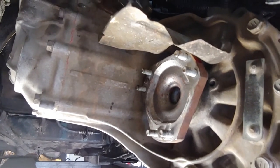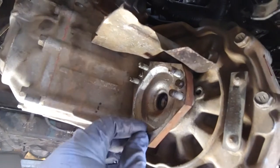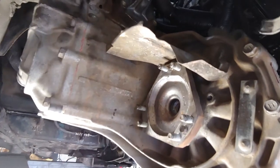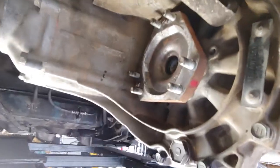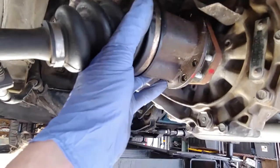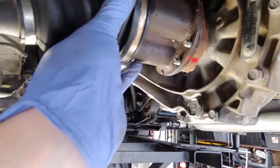It's happened to me in races, and I've seen a lot of cars where buddies stop by and we look at their axles and they're starting to lose studs on their axle output shafts. So just be sure when assembling this: mark the blank and align it with the flange on the axle that only has the two holes, and then you're home free.